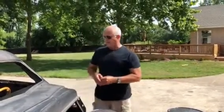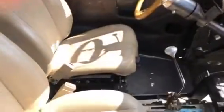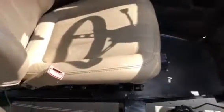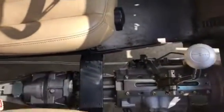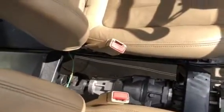horse. Then to go along with the 4L80, Gear Vendors made for us a tail shaft 2-speed, which is one of their 2-speed units. It's a planetary drive. So we removed the tail shaft on a 4L80 and installed a Gear Vendors. Gear Vendors is good for 2,500 horsepower also. We went with a 1350 yoke, which is a 2-ton truck yoke.